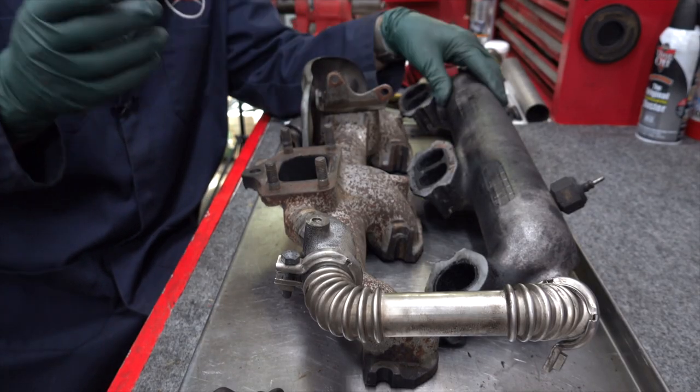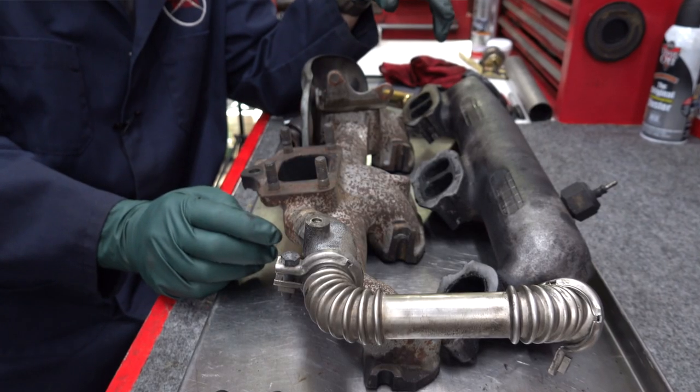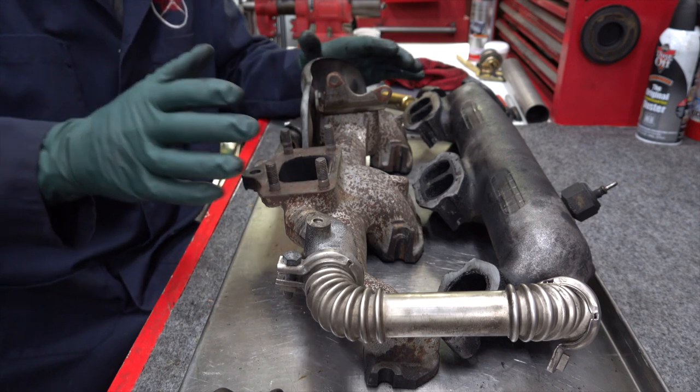Okay, we're here to look at the EGR valve. The first thing to talk about is the soot problem in the intake manifold — when does it become too much? If it gets so plugged up it restricts the amount of air getting into the combustion chamber, it affects the fuel burn. You're not getting the right air and fuel mixture so it won't burn properly — that could create the smoke. But from what we saw, it's not enough soot to really create a huge problem. I want to focus on other things and not spend time on what may be a waste of time if we decide Digby's engine is not worth saving. Understanding the theory of operation behind the EGR system will help you troubleshoot it better in the future.